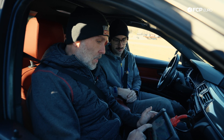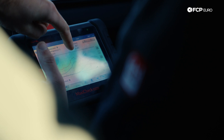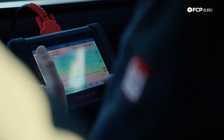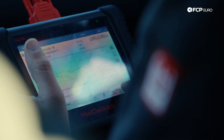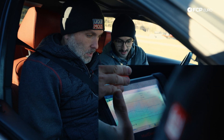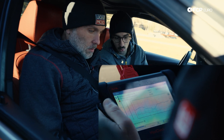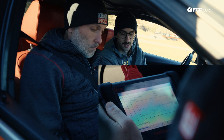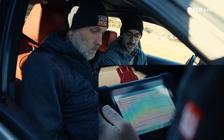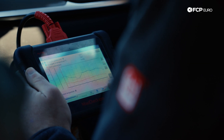This is when we're sitting at the skid pad and going into that sustained left hand turn. You can see it spiked when I hit the gas and then it just falls off a cliff — 19 psi — and just stays down there. Five seconds, six seconds, seven seconds — it still hasn't recovered. This is truly worst case scenario. We're at 3,400 rpm, on the gas, applying torque, and we're at only 22 psi of oil pressure. That is where you could kill a rod bearing, a main bearing — you name it in an N20. And for all we know, this could be responsible for a lot of the issues people have had with N20s. 18.898 psi at 40 miles an hour, 50 percent throttle — NASCAR style does not like it too well.